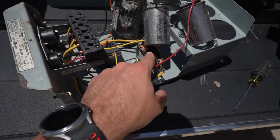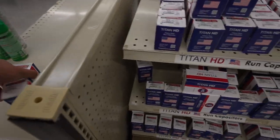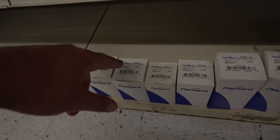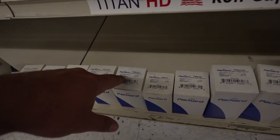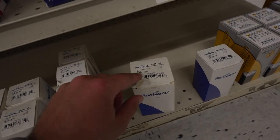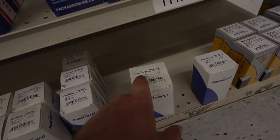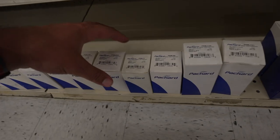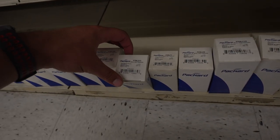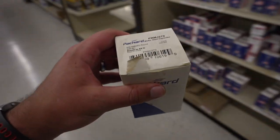This is a 30 amp 240 volt coil. For replacement, one option is 233 to 280 microfarads but it's only rated up to 250 volts. Or I could go a little larger — 270 to 324 — it's a little heavy on the microfarads but it's rated for 330 volts. I think I'd rather protect the voltage rating and go a little high, since I don't think that motor is pulling that much and it's only a start capacitor. I'm going to go with the higher one to get the better voltage rating.